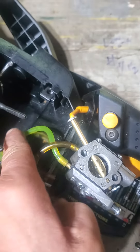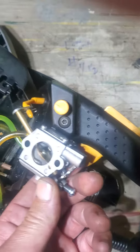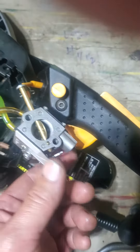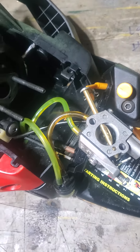This line just kind of goes back and sticks into the tank a little bit — I guess it was supposed to be the return line, but I don't even know how to get this back together right. And it's not running right. It runs good when it's running, but then I'll get it started with a little primer and it'll run good, give a little throttle, and then it'll die like it's not getting fuel.